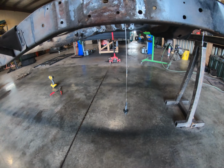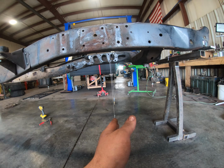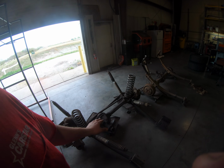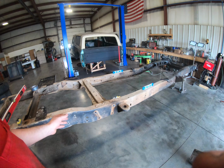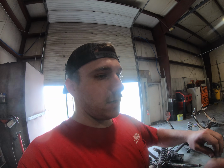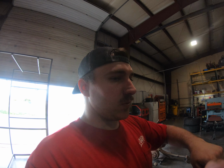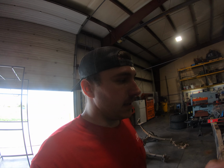And then I just have some kind of made plumb bobs, and I set them up so that way I can take my front axle apart, put it on jack stands, get it lined up, and then I will set it underneath there, and then do the same back here, set it so it'll be with the tires on it. And then I can start taking my measurements of where I want my links to go, running a piece of tape, maybe mocking up where the drive shaft is going to be, making sure everything's going to clear front and back, and just keep going that way.